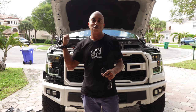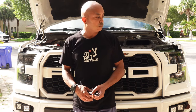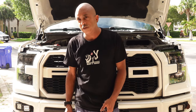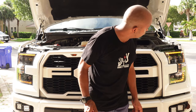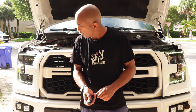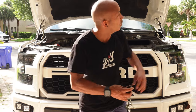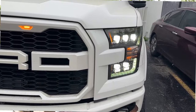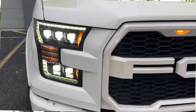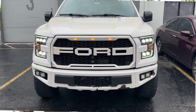Obviously, reconnect your negative terminal before you complete everything and before you test it. Now go ahead and put everything back together on the passenger side. Both lights are changed out to the new Alpharex Nova series. The unlock sequence works, the light-up sequence works, and you can see the daytime running lights working. Make sure all the bolts are tight and the wires for the daytime running lights are nicely tucked away.